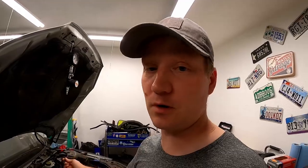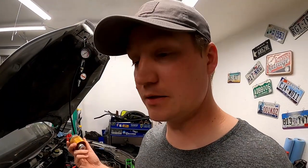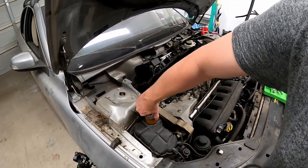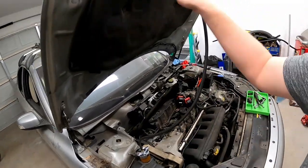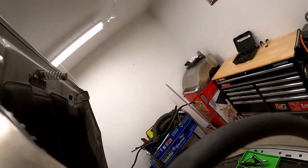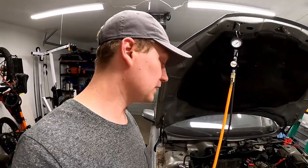There's a nice long hose to feed down to wherever your cooling system reservoir is. I've got this adapter here — it was not included in the kit, I had to buy it separately — but if you're a professional mechanic you probably already have half a dozen or a dozen other cooling system adapters anyway. This will work with all of your old cooling system adapters, so you're not going to have to go out and buy all new ones. You just attach the adapter, release it, then attach your shop air supply to the bottom of the tester. You are going to need a compressed air supply of some kind to be able to utilize this tool.